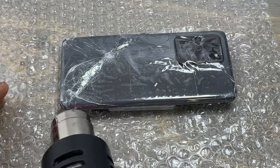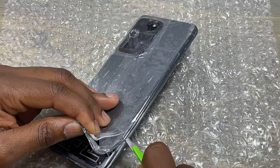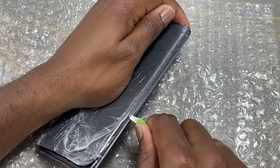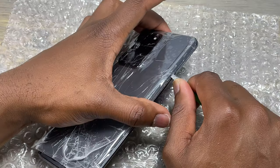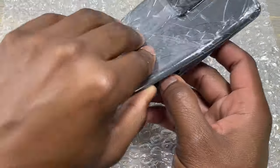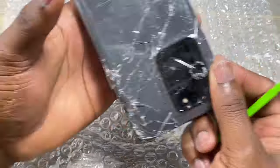The only thing different here is that we are not going to reuse this back cover. The glue behind the back cover of this device is really thick and really strong, so use some heat if you need it because it will make your life easier while replacing this back cover. You can use some duct tape to protect yourself by applying it on the back cover — it will help you prevent the dispersion of broken glass everywhere. You need to use your tools on all sides of the device before you will be able to remove the broken back cover entirely.